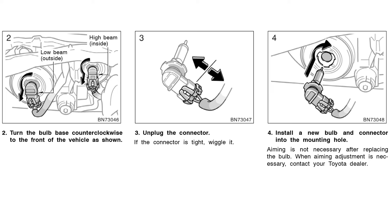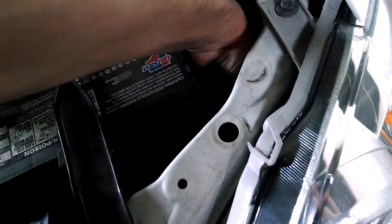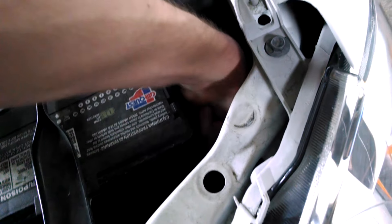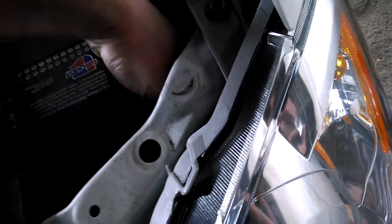This is what you're looking for from the back — this is what it's going to look like. If you're facing the front and looking at the left bulb, whichever bulb you want to switch, you're going to rotate it counterclockwise with regards to the front of the vehicle. I'll upload the link to the online owner's manual as well, which can be helpful. Once you've got the air filter moved out of the way, reach down and grab the back of the bulb housing and twist counterclockwise with regards to the front of the car — or if you're facing forward, to the left.